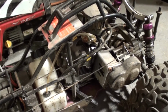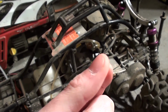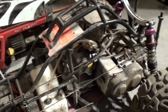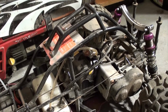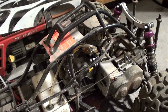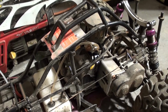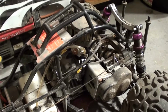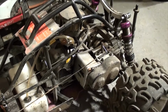But when it's got mud in it and bits of grit, that will make its way through over time. A day's use. If your air filter's soaking wet, the grit is going to be like sandpaper in your piston and in the engine, because the two-stroke as well, it'll go down in the crank and all kinds of stuff. So you don't want to be getting it wet.